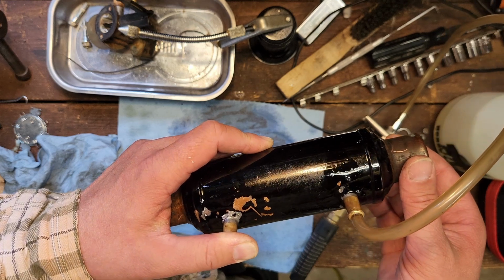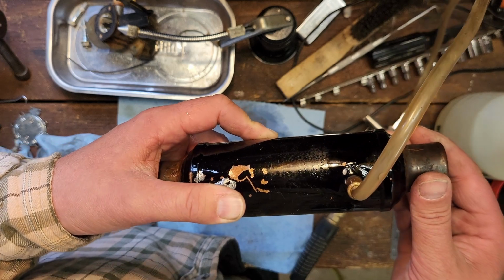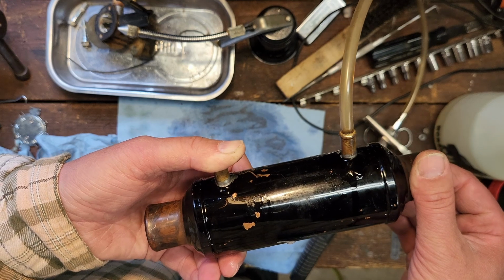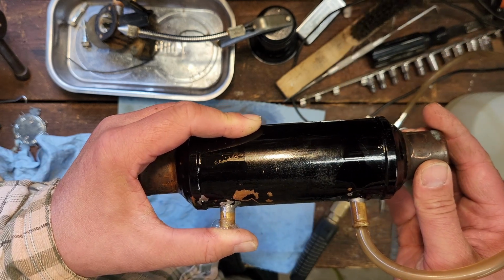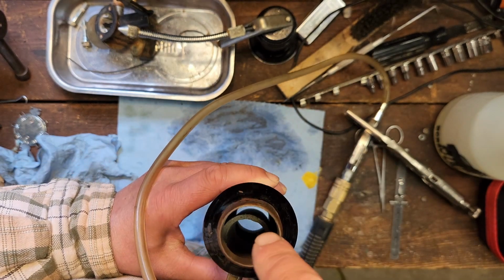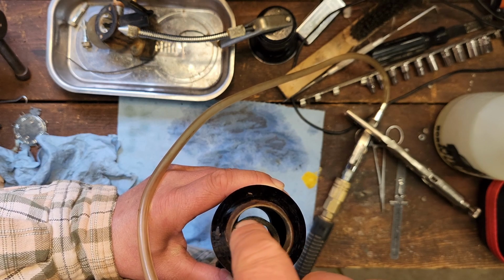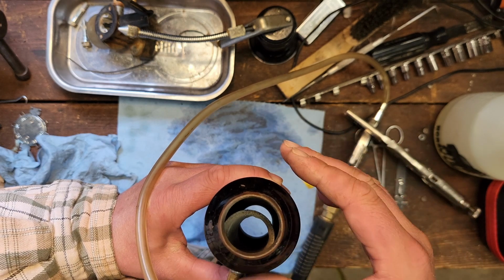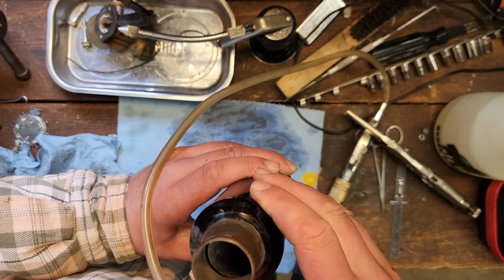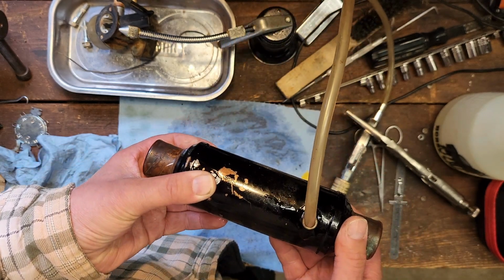I'm happy that we took the time to take this off and diagnose it. I'm irritated that I went through all that work and this thing's in good health. I'm happy that I don't have to drop 150 bucks. Anyway, that's what the inner diameter looks like. I believe that the power steering fluid flows through this inner tube and the shell of that tube, and then the water from the lake or wherever you're driving flows through and cools it. I believe they call that a tube-in-tube cooler. Kind of makes sense, right?